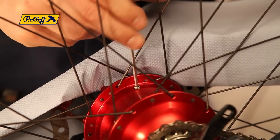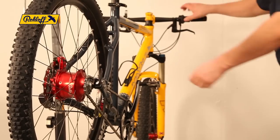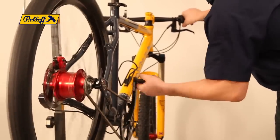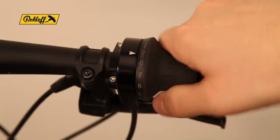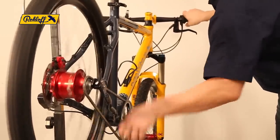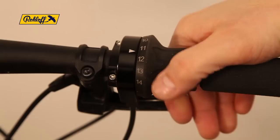The actual rinsing process occurs with the rotation of the cranks both forwards and backwards, whilst shifting between gears 3 and 5 for approximately 3 minutes. This process can be completed either in a repair stand or by taking a short ride.